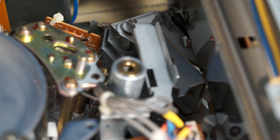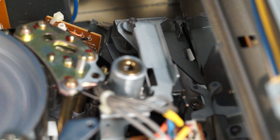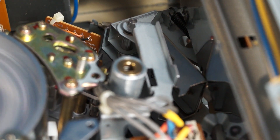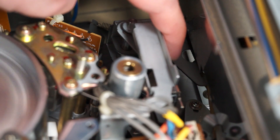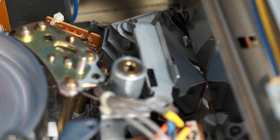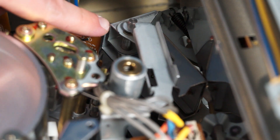So as you can see, if I put in the tape and hit play, you can see how that engages. You notice that it is in that position. And if I hit stop, you see how it comes out like that. What was happening was that it was stuck like this all the time because it was all gummed up. So that was causing the machine to basically go into standby mode. If you look right here, there is a shaft.